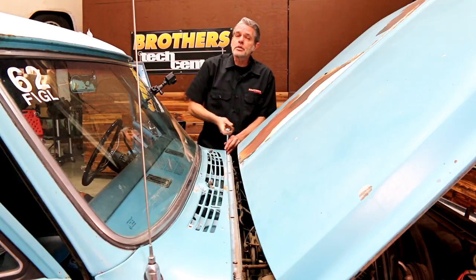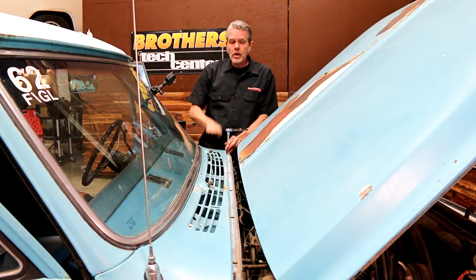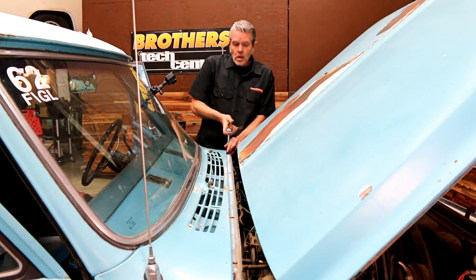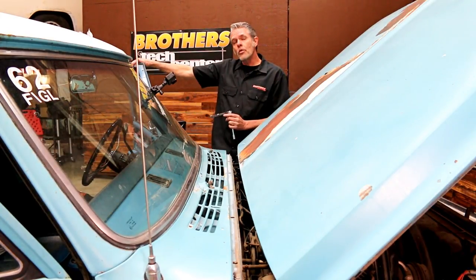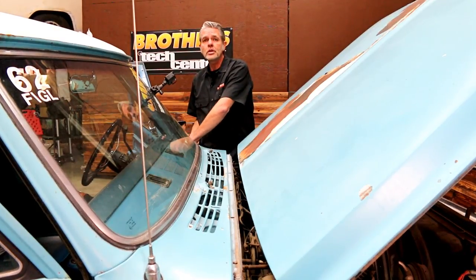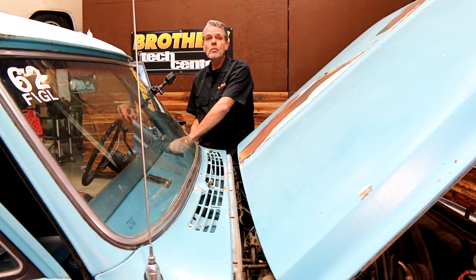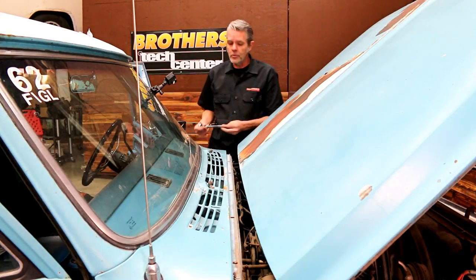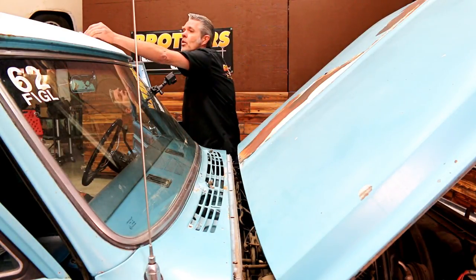One's going to be right here. Now you might have some shims on this that'll raise it up or down to help it line up with the hood. You'll need to open up your door all the way. There's another bolt right here that also might have shims on it. If they do, make sure you take them out, save them, and mark where they went so hopefully your lineup will go right back to where you want it.